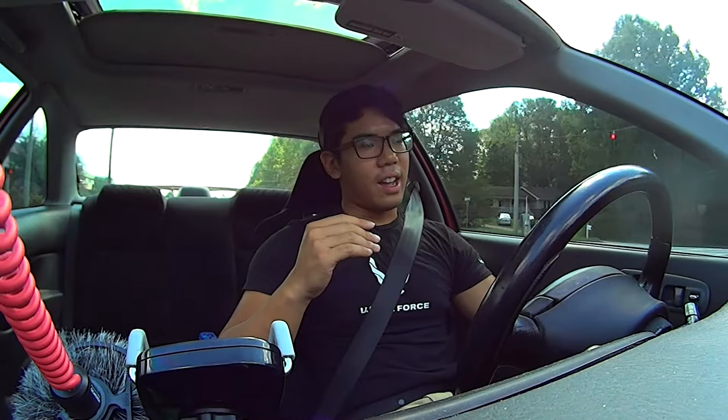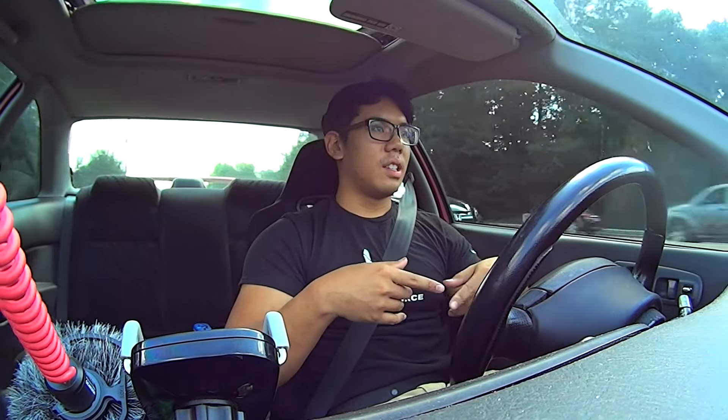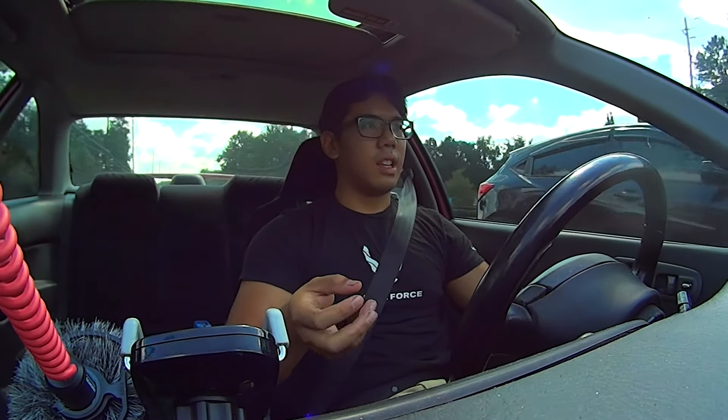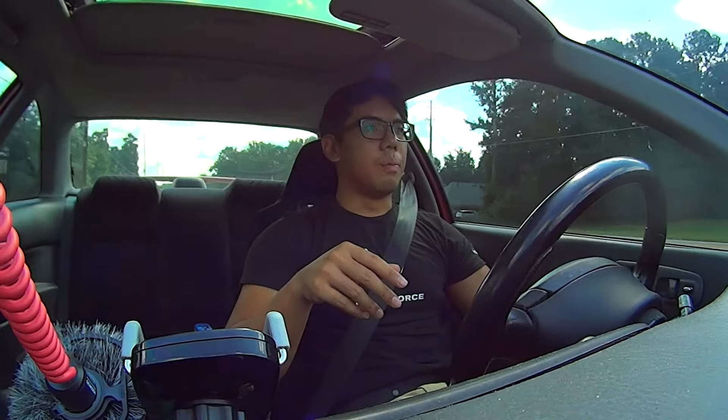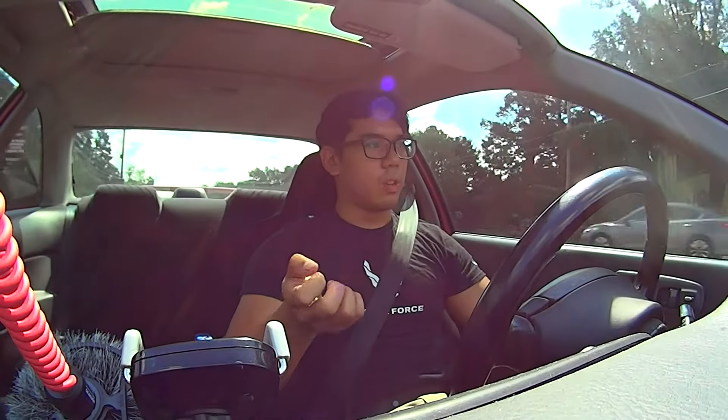Which I like. If you have a car that you feel has no balls, putting motor mount inserts in — or even filling them and making your own inserts from polyurethane and leaving it overnight — even that will make it feel like you're driving a much more impressive car.